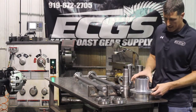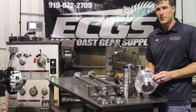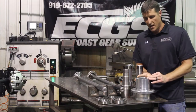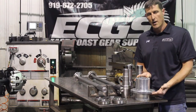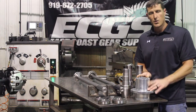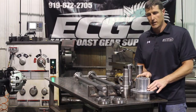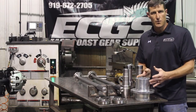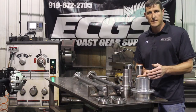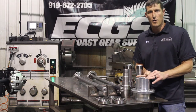The other thing we did was the pilot on the back side of the wheel hub. This will take the cheap 14 bolt disc brake kit that a lot of different vendors sell, so you can do the rotor on the back side of the wheel hub for a cheaper brake kit. Or you can do our hat rotor that has the E-brake built into it. We created something that's E-brake compatible, ABS compatible, and ready for your hardcore off-road guys.